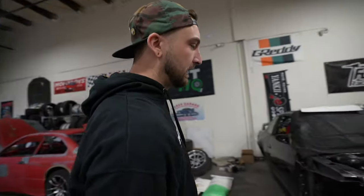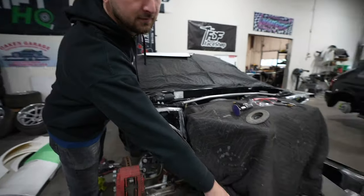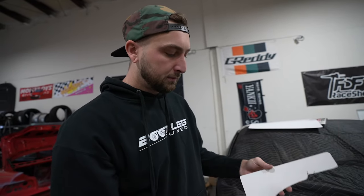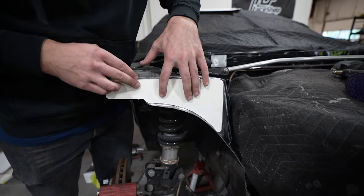What is up everyone, the big thing right now is we're going to recreate the front of my S13. In the last video we did the lower rad support. Now we have to move on to the next structural part, which is the strut tower, and we have to tie it back into the rail. To do so we have to plate it right here because it's just flimsy metal, and this will give us a foundation to build off of.